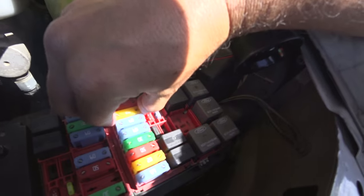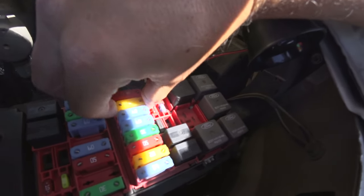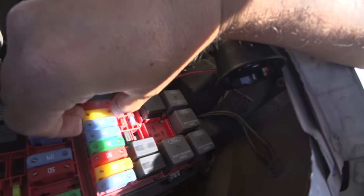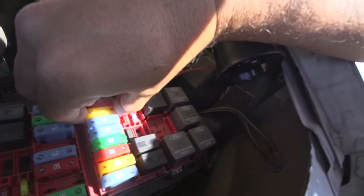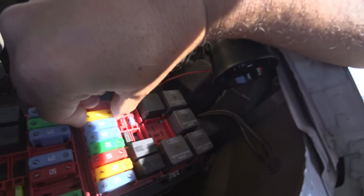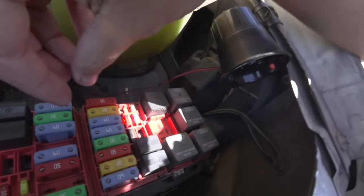But we need to get this fuel filter changed, because I think that's what's giving me my hard start still. I'm still having hard start problems. The battery is usually 12.8, 12.9 — the lowest it's been is 12.6, 12.5 — and it still starts, but cranking hard.